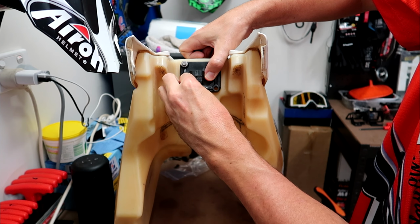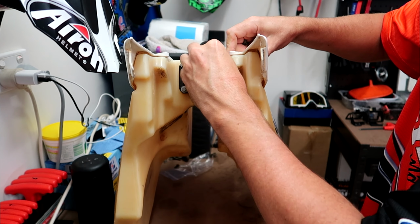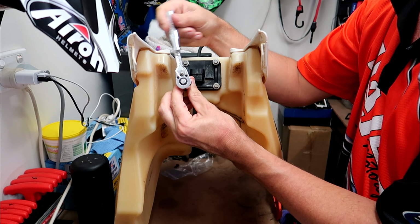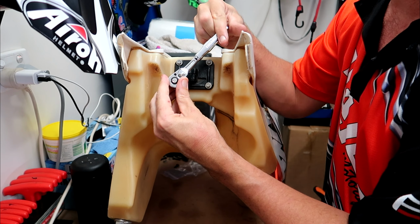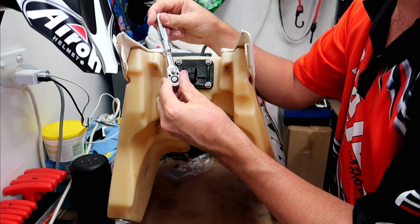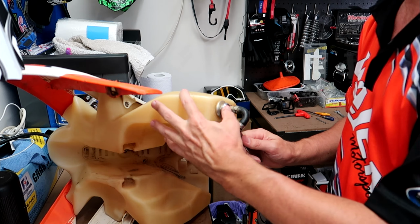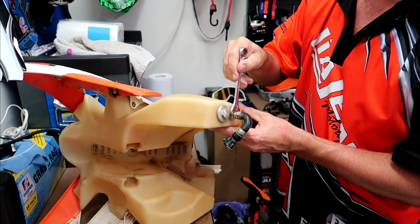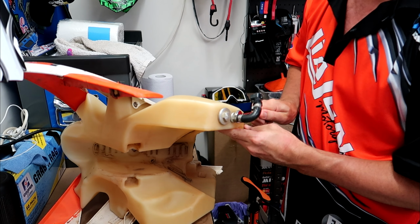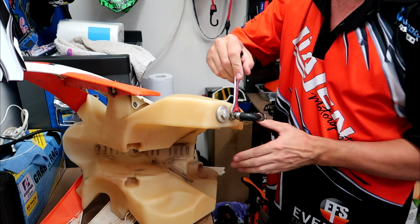And you can screw the top bit of the pump into place with the 4 screws and the 6mm socket. You really don't want to over tighten these little screws either, it will strip out that plastic pretty easily. That done up, you can use your 17 and 13mm spanners to tighten these two guys up. You don't want to over tighten it, but you want to make sure that your outlet hose is facing the same way it was when you took it off, so spin it around till it's facing sort of back and in a little bit.